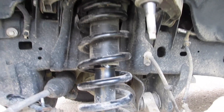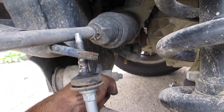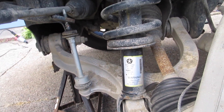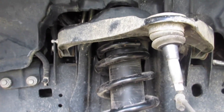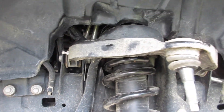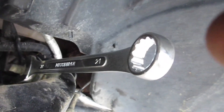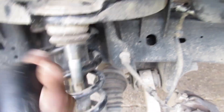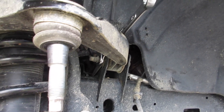Got the whole strut mount back in. I really recommend having somebody help you right here — go on the other side of the sway bar up underneath this bolt and have them pry down. I don't think I honestly could have done it by myself. I'm going to be switching out the upper control arm because of all the negative things I've heard about the Ram's upper control arms when you put on a leveling kit. There's a bolt here — the inside one is a 21 millimeter and the outside one is an 18. Keep an eye on the plate orientation: you want this plate on this side of the frame and that plate on that side, because it actually holds when you're tightening it back down.